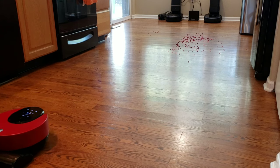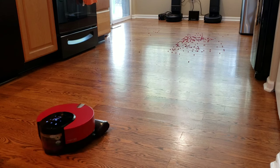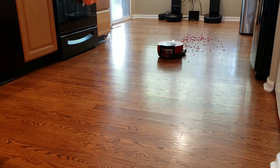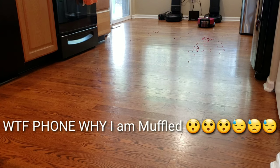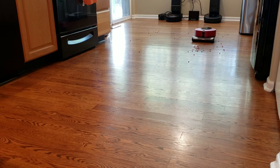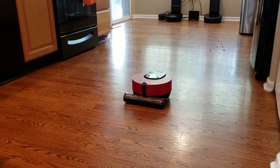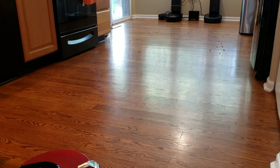Besides the LG being a really odd cool-looking robot — in my mind I think it's one of the best-looking robot vacuums out there — it stands pretty tall at 14.3 cm, so it does definitely struggle getting underneath beds and low-hanging furniture. Due to the odd shape of this robot, there are a lot of edges and corners the robot can easily get hung up on, kind of like a D-shaped robot. But fortunately LG thought of this and incorporated a very robust navigation system. It includes both a camera and 3D laser system which does really well detecting glass, clear, and even black objects. It also can detect thin chair legs, and the robot also can recognize people and tell them to step aside if you happen to step in front of the robot as it's cleaning.